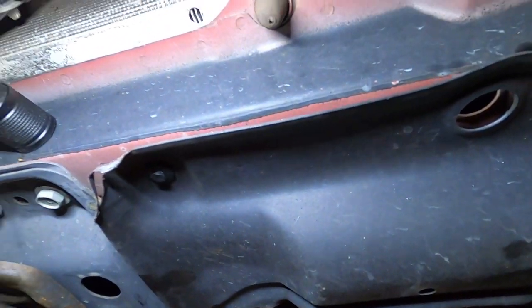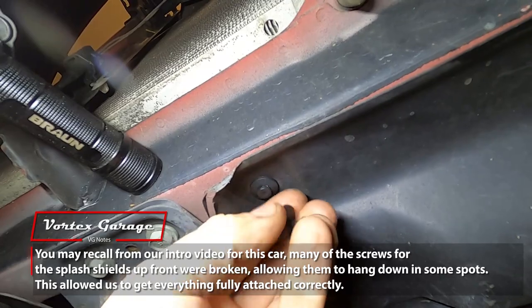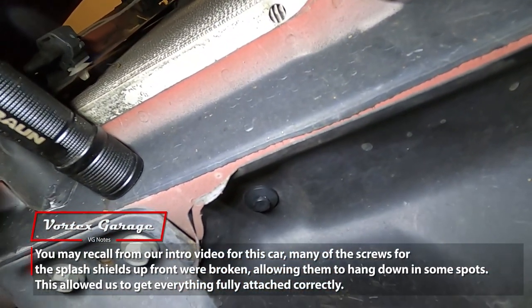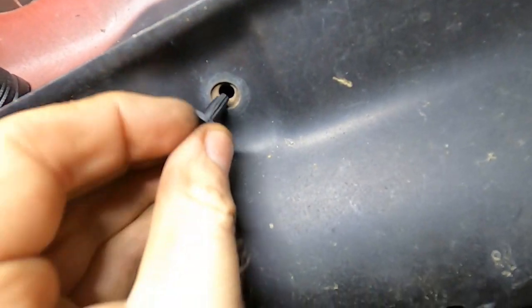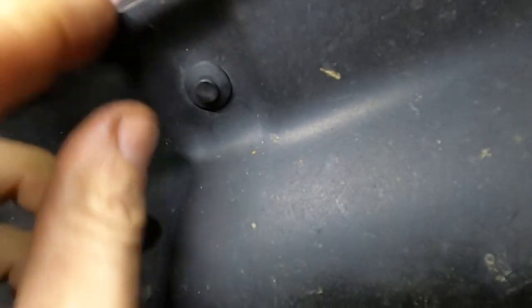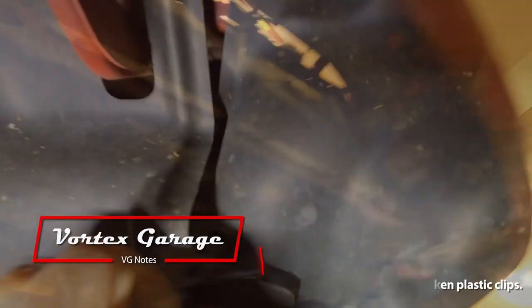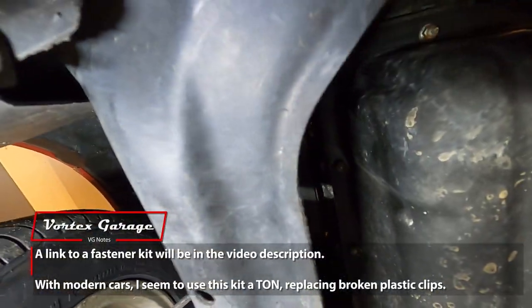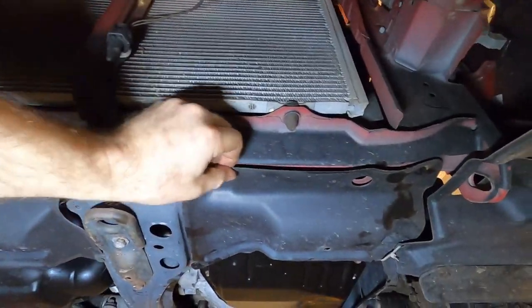As you can see, we're replacing all those little rusty old screws with pushpins. All we had to do was pull out the little yellow plastic inserts, and then you can go ahead and pop one of these in, push it, and it locks it in. That solves all of our falling heat shield problems.